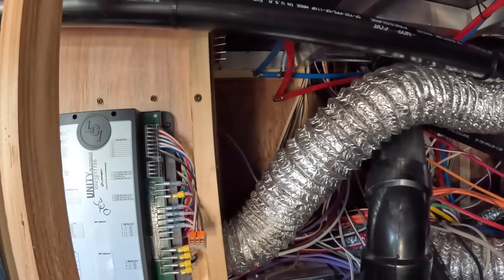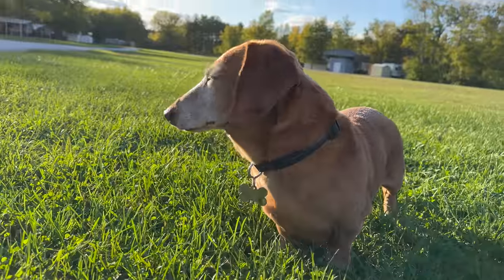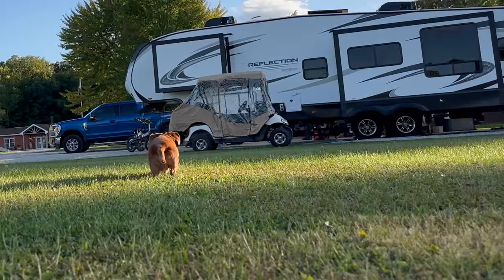Now that we've got all the stuff out of the way, we'll take a few screws out, pull this basement wall back, and that gives us access to everything again. Kind of a mess in there — this is what it really looks like under the basement of your RV. I'm going to pick a couple of centralized locations and throw these next sensors in. One thing you really don't want to do is tape or glue the sensors down because you'll eventually need to change the batteries. Some people just put a screw in the floor on all four sides to keep them from sliding around while going down the highway.